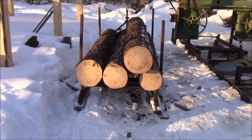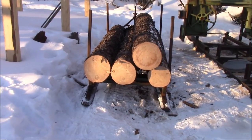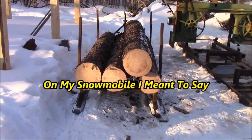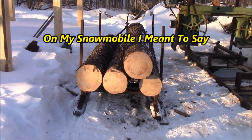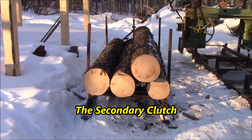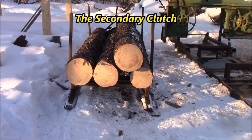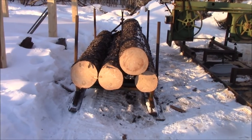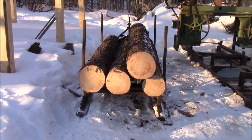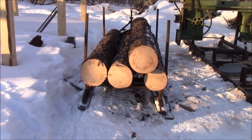We got it to here, and then I went. I put another belt on there. It was brand new and I'd had it for a while now. And he brought out the tool and we pulled the secondary off and I lubed that up. The buttons are all good in it, everything's good in it, but it was really, really dry, and I put a little more wrap on the spring. The secondary is supposed to have about 10 pounds, I think, or 12 pounds. And I went about 22-24 on that secondary, and now I'm telling you it pulls good.